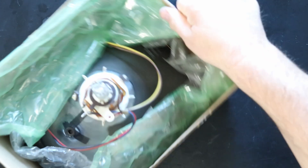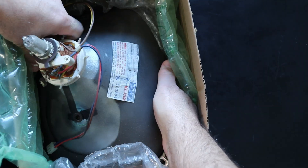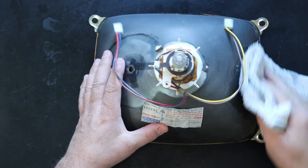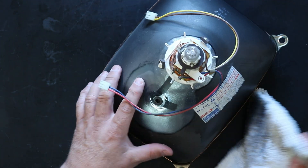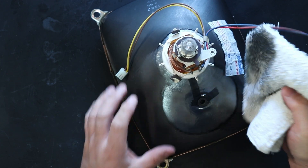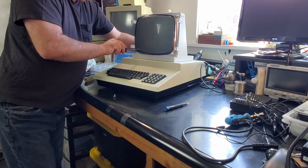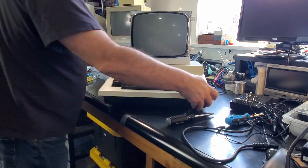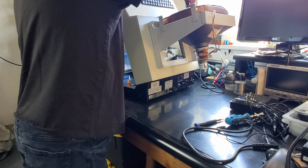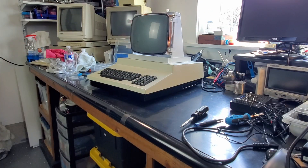Now it's time to bring out the CRT that's been secreted away in a secure place for a couple of months where I've paranoidly been careful not to break it. It looks pretty good, so we can just carefully wipe it down with water. You can see just how much soot and gunk builds up on these as they're used, and a school district machine was probably used quite a lot. The CRT mounts in the CRT chassis with four screws with large washers. The original washers were in good shape, so I reused them with replacement screws. I was very careful not to damage it, especially the delicate neck.